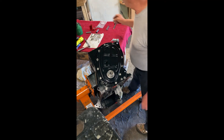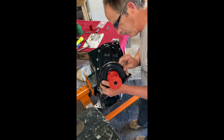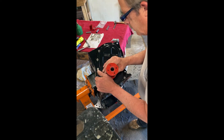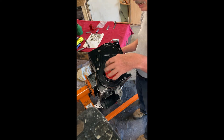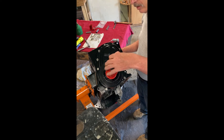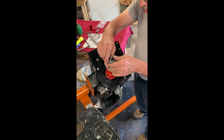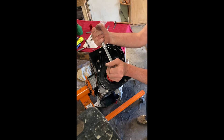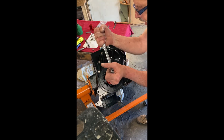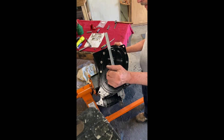The last thing I'm going to do here is put on the dampener wheel - the dampener pulley, the big pulley on the front of the motor. There we go - put our bolt in. I am not going to torque this down at this time because I don't remember if this has to come off to slip the engine in the car. So we're just going to snug it in for now and I'll check up on that before we put it in.